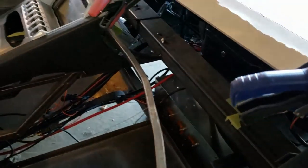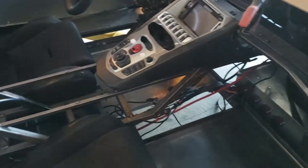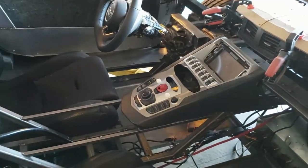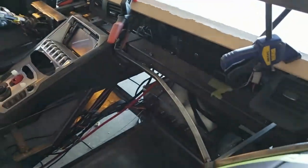As you can see we've got this door panel in, we've got it gapped, we're making our structure. I have this curved piece here — I think I'm going to straighten that out to make it a little easier to form the dash. It actually is straight in the original. The reason it's bent like this is because we still have to fit the gear shift in there, and I don't want it so far back that it's an absolute pain to drive the car. So the console has to move forward a little bit — we're making those adjustments. I still think it'll look good and I don't think it'll detract any from the interior.